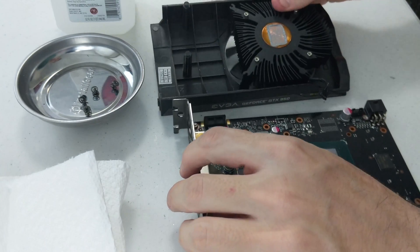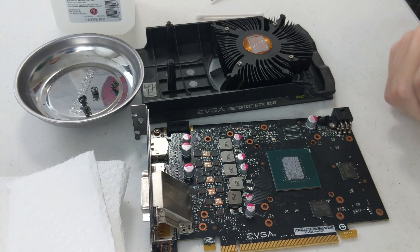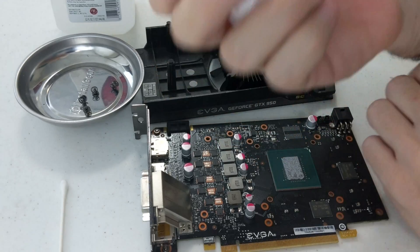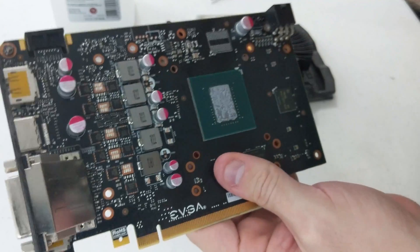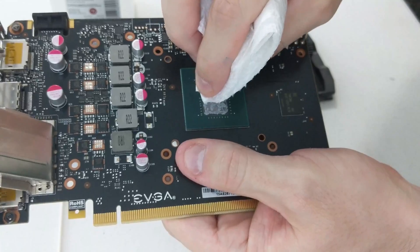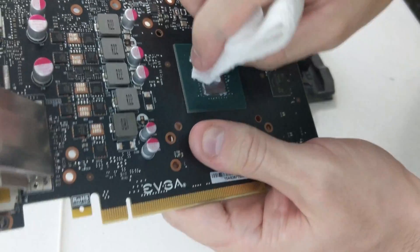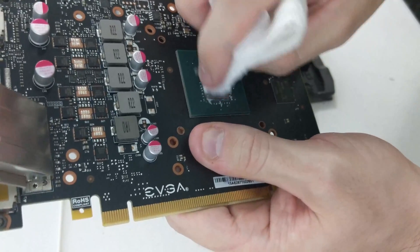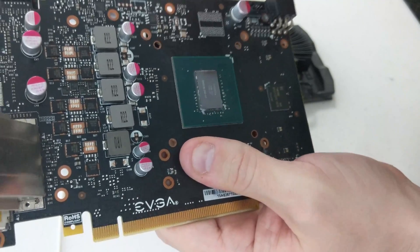What we need to do now is remove the old thermal material from the die and the copper plug — that's why I have a paper towel right here. Take a clean paper towel and really get in here and wipe it off. Make some firm strokes to get the crud off first. As you can see, that's actually coming away pretty good — this is pretty high-quality material. The harder it is to get off, generally the lower quality the material was in the beginning, because that means it's hardened and stiffened over time.